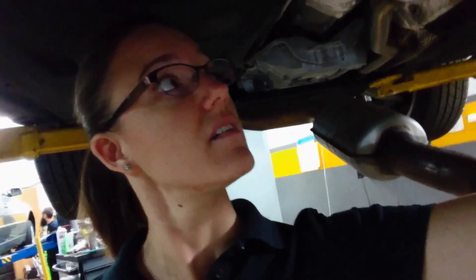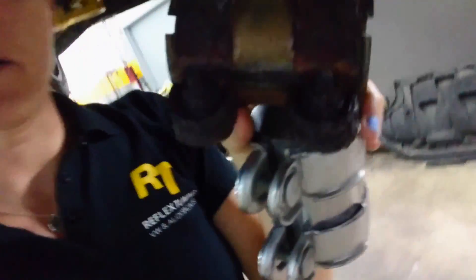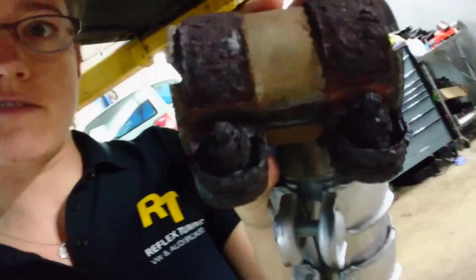The Volkswagen and Audi exhaust systems are made of stainless, so they do last a very, very long time. However, the clamps — the bands — are not made of stainless, so they will rust out. If you look at the old one here, I'm going to take it off. You can see right in there the bands have rusted out.